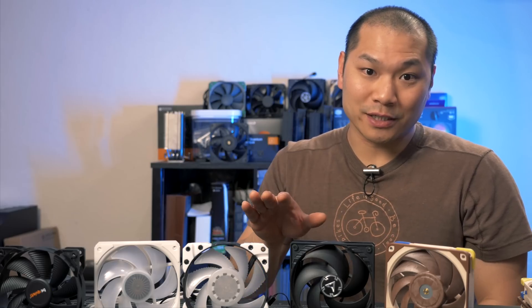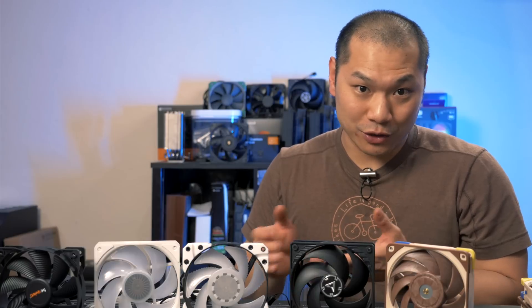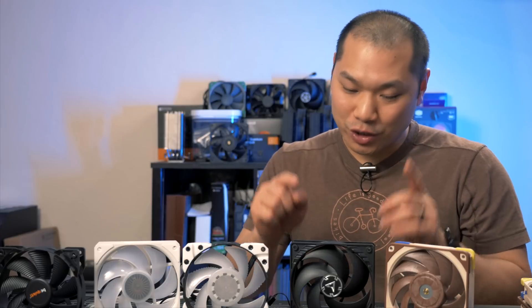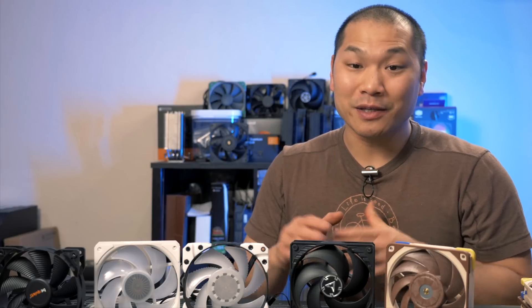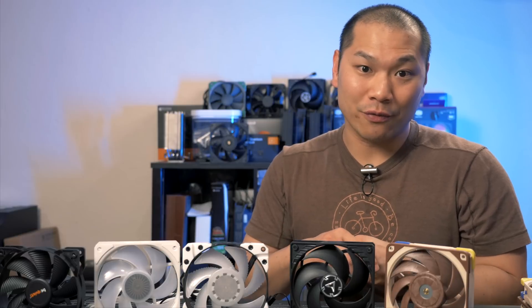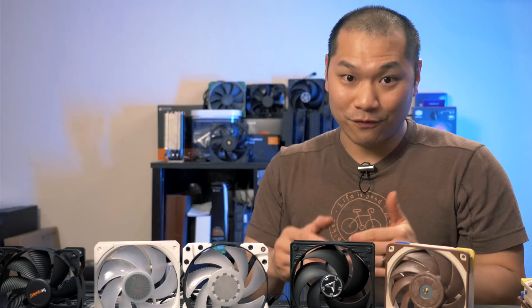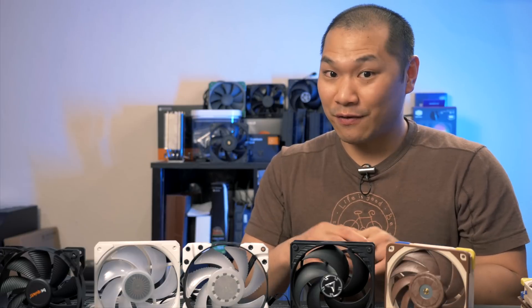This is a bit of an inconvenience if you plan on using the P12 as a water cooling fan. The easiest way to mitigate it is to lock the fan at a fixed RPM — say 1150 or something outside whatever range causes the growl. It's really more the change in RPM that causes it, so if you can fix the RPM then this fan is definitely serviceable.